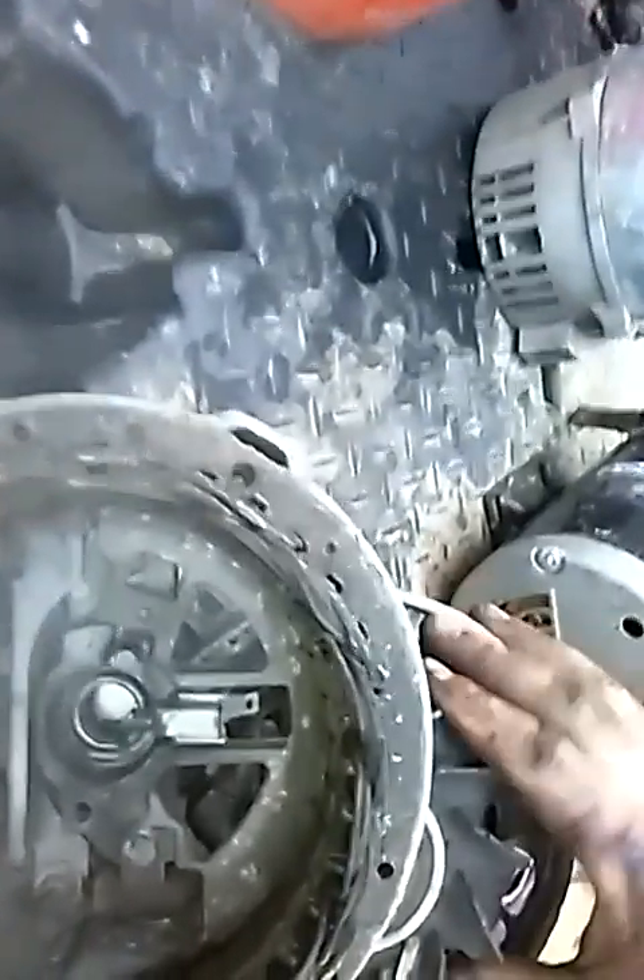I've got another one taken apart — let me show you real quick. Same alternator. You've got a copper connection here — same alternator, same one. The only thing that can ever go wrong with any of these alternators is these two little brushes right here. Here's your stator coil — it's got three separate wires on it, and those three wires go to these three poles that have a diode on each side. It rectifies the current from AC and regulates it down to a certain voltage — 12 to 14 volts depending on the speed.